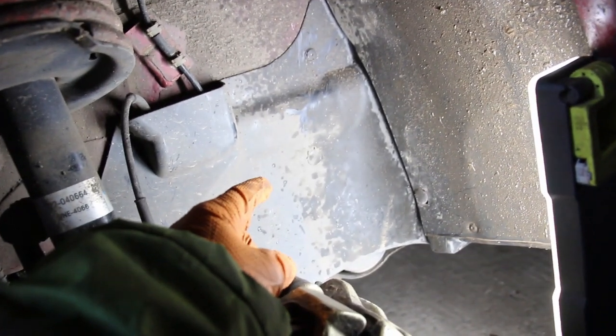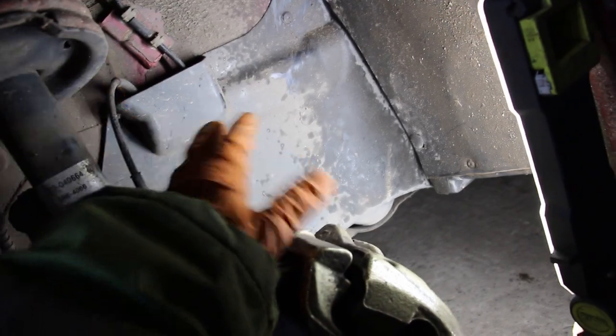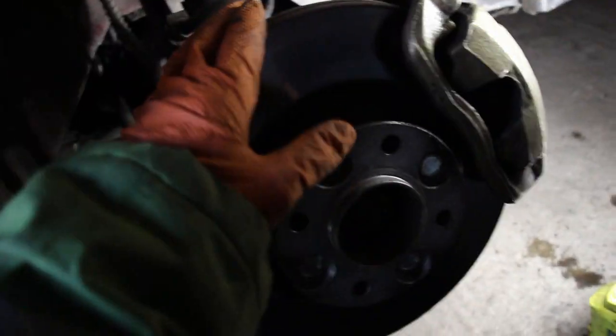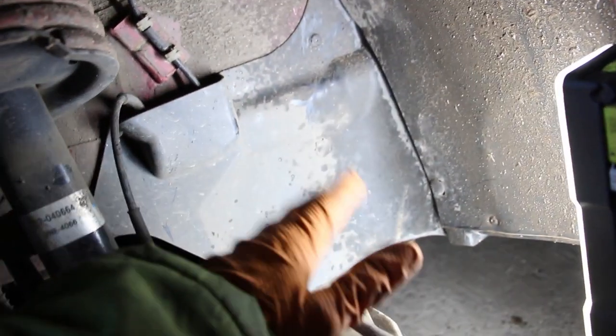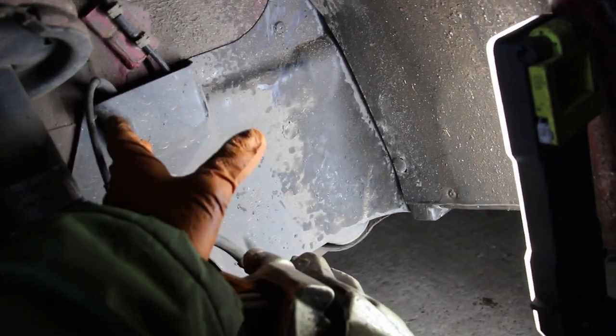So there's an auxiliary belt tensioner, a manual one behind there that goes along with the automatic one, and it is not working. Oh yeah, wheel bearing. I had to put a new wheel bearing in, so I've done that. The tensioner is squeaking, and it's got play in the bearing. It's only 6 months old.